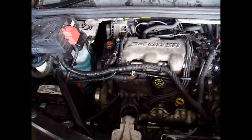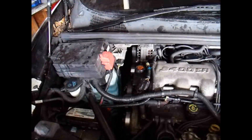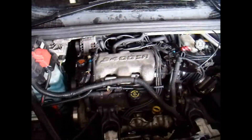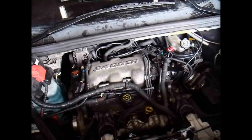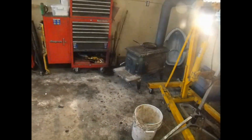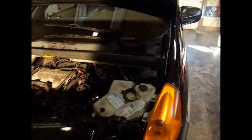I'm going to replace the gaskets with some good Felpro stuff, and this engine should last for another 150,000 miles. I already did the rest of the tune-up — spark plugs, wires. If you keep these things maintained and get the gaskets fixed, they're pretty good engines and should hold together for quite a while. I've got everything set up, got my stove on, going to go ahead and jack it up and put it on jack stands.